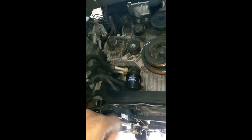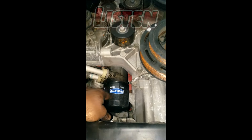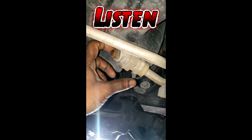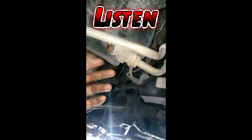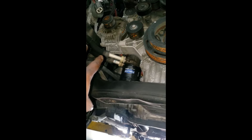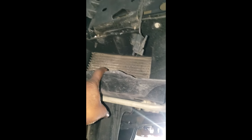This is a Dodge Challenger. Somebody was asking about draining the oil on the oil cooler. All 6.2 supercharged Hellcat trim engines include an oil cooler. The oil cooler is right above the oil filter and has two lines running out in front of the bumper — the bumper is off this one so it's very visible. Take a half-inch and drain the oil out when you're doing the oil change. Reach up under the cowl and drain the oil out of the cooler as well — they do this at the dealer too. You want all the old oil out because that oil is circulating through there.